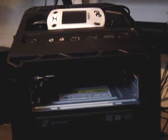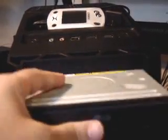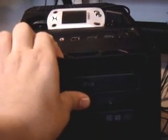I recommend that you install the drives first, because on some cases, unlike this one, if you push it in, it goes in smoothly and you can actually push it in too far. If you push it in too far, it can actually fall back, and if you have your motherboard installed already, it may break something like your motherboard.